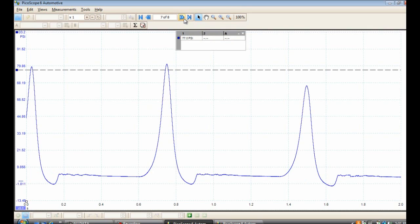So what we decided to do was put some oil in the cylinder, just to see if that had any effect on the cranking compression. I put like three capfuls of oil — the little cap — three capfuls is how much I used.